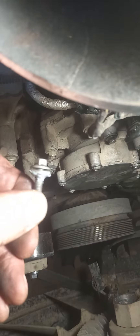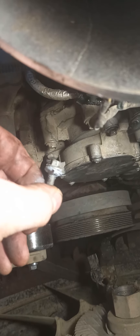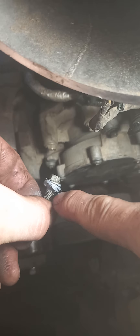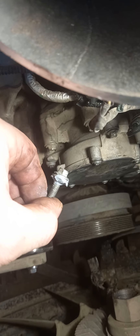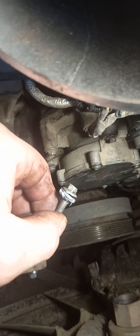I like this International Ford pan gasket — stuff's pretty wicked. It doesn't take a whole lot. When you shove it back in there, some of it will be inside the bore on the threads and some will just be on the washer. At least that way when you go to break it free, it'll just tear the silicone instead of the threads. Cheers!